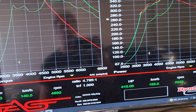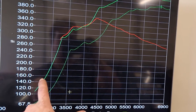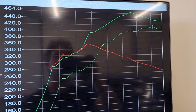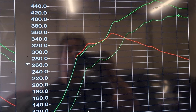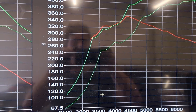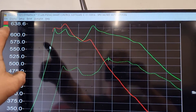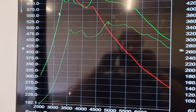Just finished the unrestricted ethanol tune — this is the one we expected the most power out of. The green line here peaked at 460-odd wheel horsepower. Comparing it to the old engine with the same boost, same turbo, same fuel, the old one made just over 400. So we basically gained 50 extra horsepower just from changing the motor. And it's not just up top — there's a very consistent increase in power over the entire rev range. Over on the torque, this has far surpassed my expectations — we're up to 630-odd newton metres, which is a hell of a lot out of a four cylinder. This thing should really be quite an animal to drive.